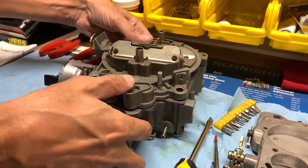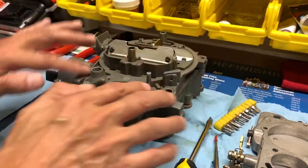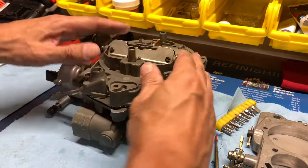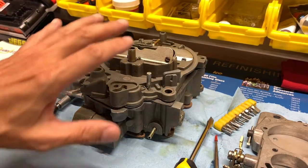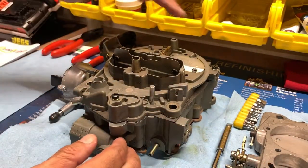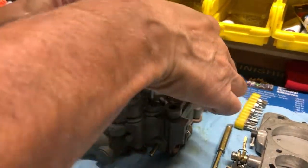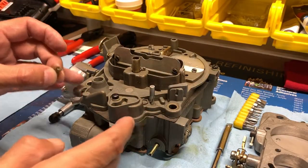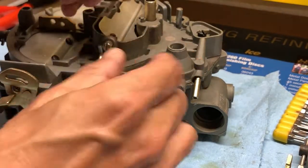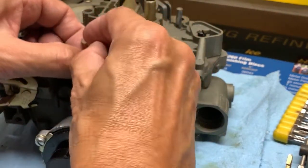So I got the air horn going back in place, with the accelerator pump in place. Everything is looking good. Before I do the choke flap lever, I'm going to start some of the screws around the air horn so it starts pushing everything and keeps it in place — I don't want anything to move. I connected three screws, and now I'm going to install the two that go in here. Everything is looking really nice, and next I'm going to install the choke flap lever.